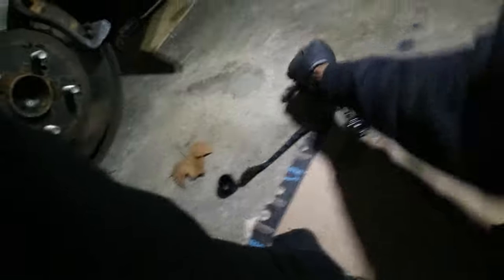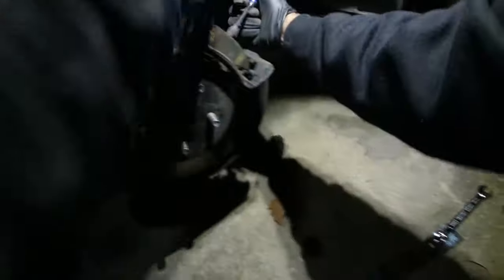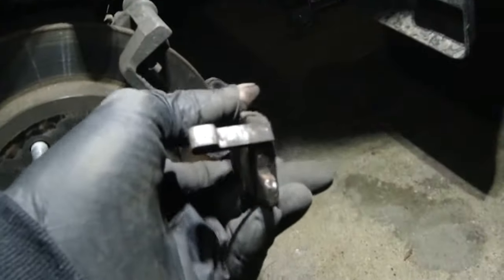It is tiring working on cars. The inboard side has the wear sensor — the wear indicator — and it's really worn. The outboard side doesn't have the wear indicator on this car. Always replace the hardware. Take note of how these are: the top and bottom pieces look different. The one that goes on the bottom has holes in it, presumably so brake dust can fall out. The ones at the top have little holes too, but not as big as the ones at the bottom.